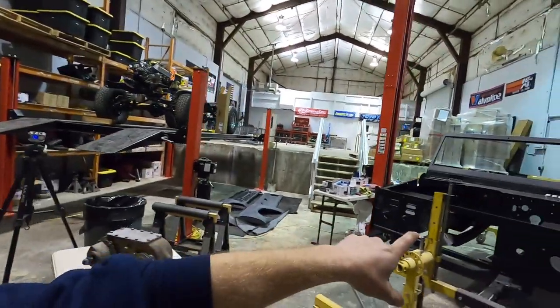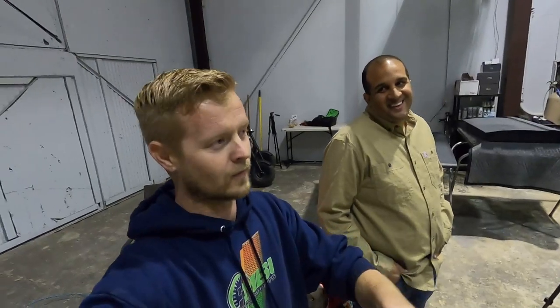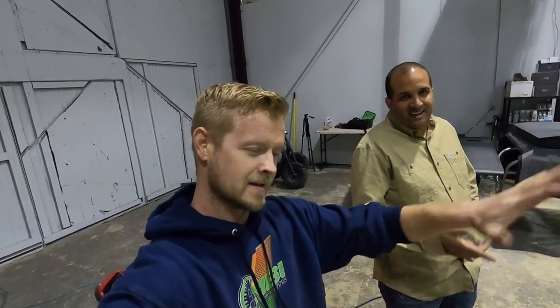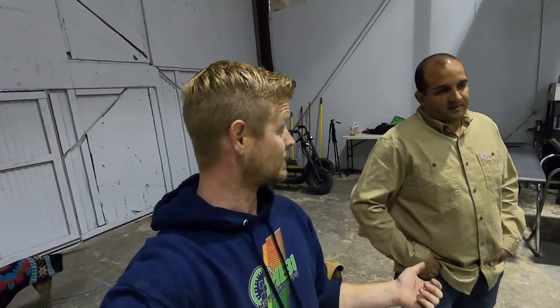We still have the body. The rest of the soft pads came in today, right? Yep. So we'll get cracking on that real soon. We're ready for paint. You guys probably won't see that. No, we're not going to sand anymore for you. You get the gist. By hand, 60, 120, 220, 400. Only with the soft pad though, not if you're using real sandpaper. The soft pads are way off. The 60 is more like a 180.